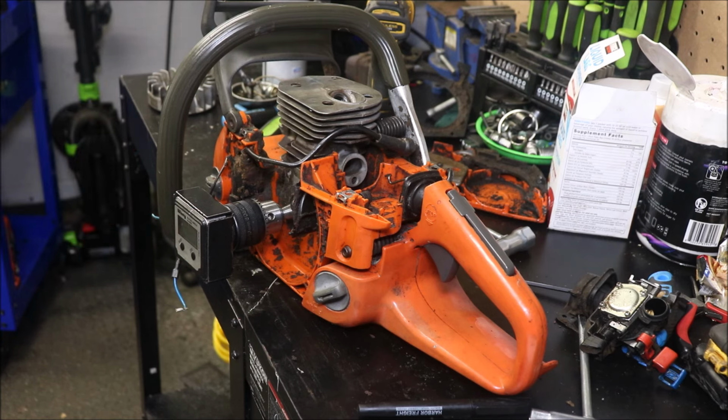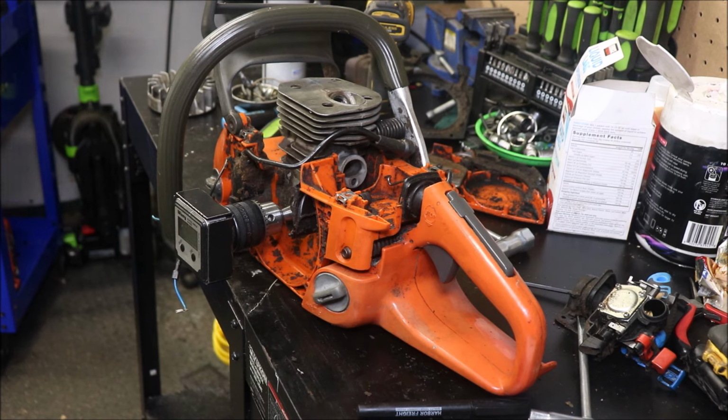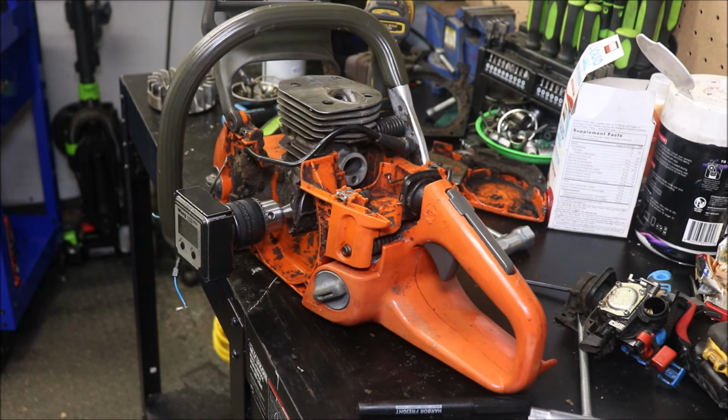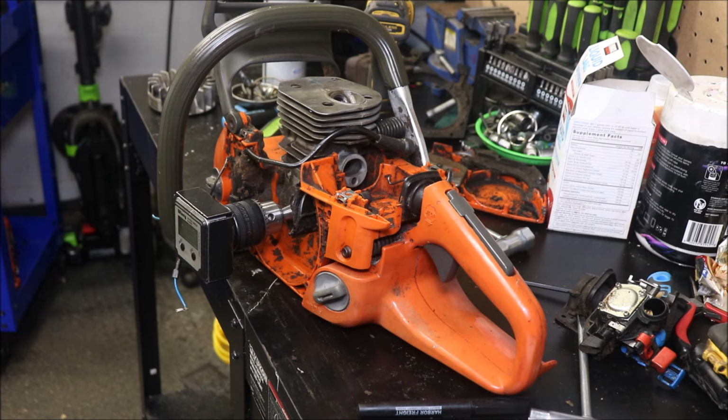I like the exhaust ridge there. We're going to do our cleanup on it. We're going to widen it a little. We're going to polish it. Not go crazy, but going to give it a little polish, because it had a ton of carbon I had to sit and scrape out of it when I was cleaning up the cylinder. The uppers may not even touch. Maybe pitch the angle on them just a little bit, but then again, may not even touch them where they're at.